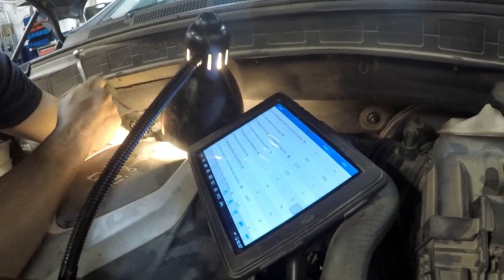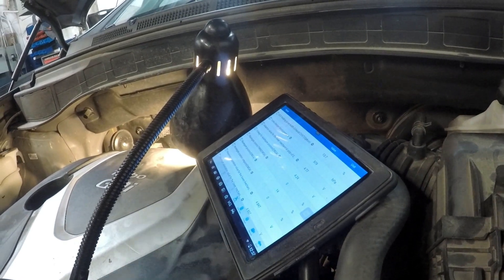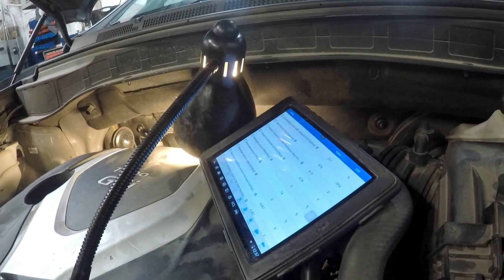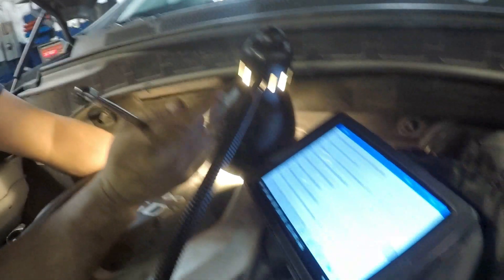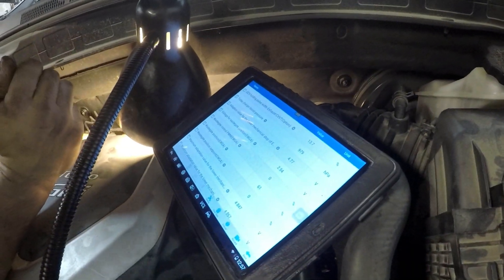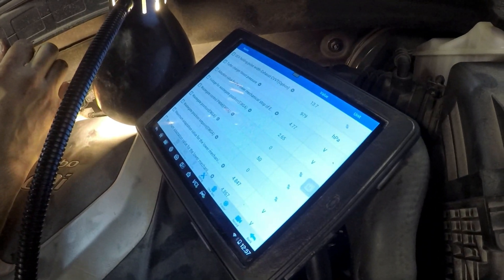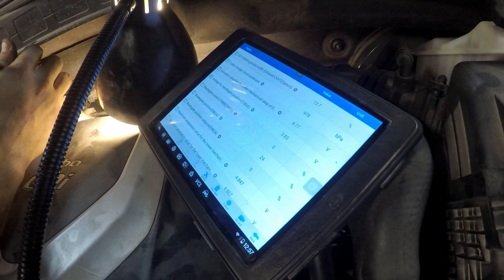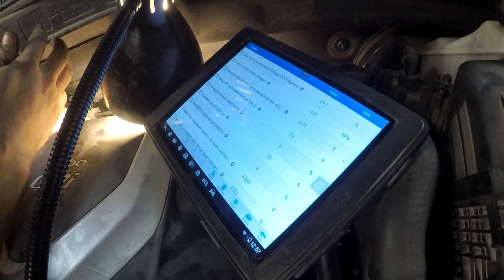That's closed and I'm trying to do it with the electronic motor — it's not going to go gently, it's going to slam. So I'm trying to adjust it to that. Like I can open this up and get 3-point-something, lower than 4. And then if I close it by hand slowly — 3.8, a little more, 3.9 — right? Yeah, that's spec.